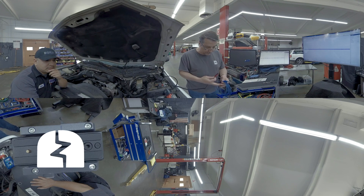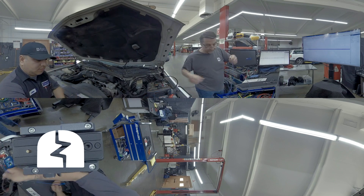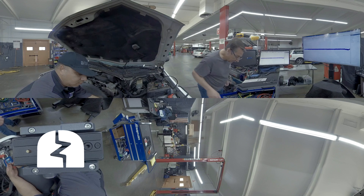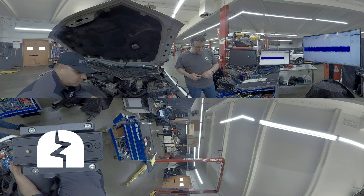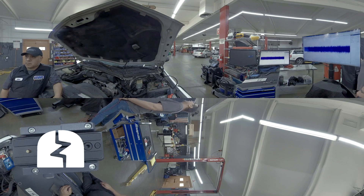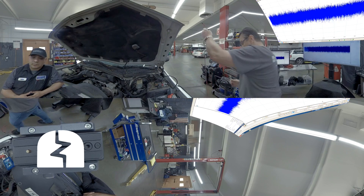On the Pico, blue is channel A. So we're going to undo this and plug this into the scope. And if you want to just hook these two leads up here, back channel those. Then I'm going to hook up the red lead into the power supply so you can watch the voltage and the amperage at the same time. Okay, we're now recording.